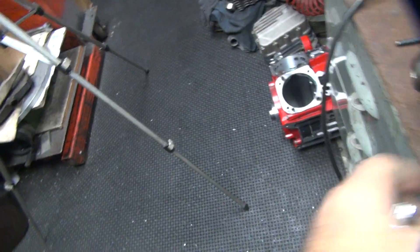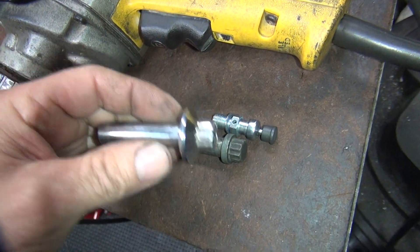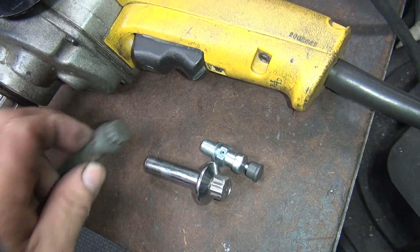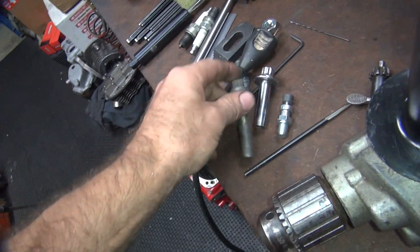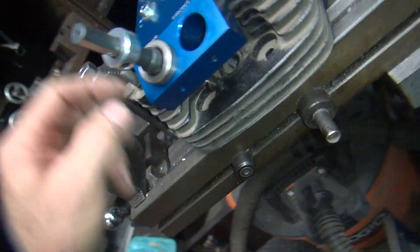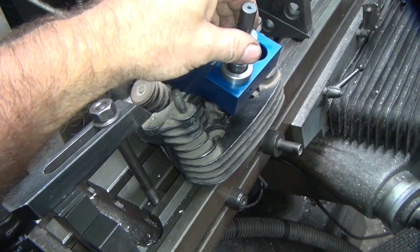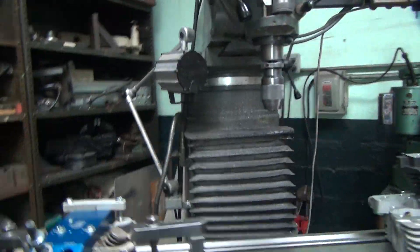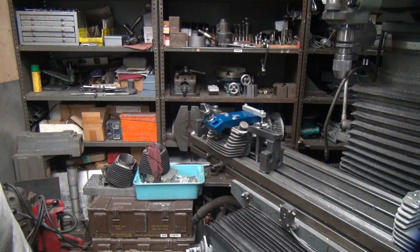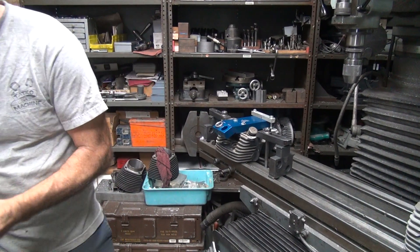So the compression release and head bolt can occupy the same space with S&S bolts, whereas with the other style it's probably going to be overlapping or right up next to it. Like I said, until you poke the hole in you don't know. I think we're just going to punch the hole and see what happens — all you need is to screw up a $200 head, but make it work or not.